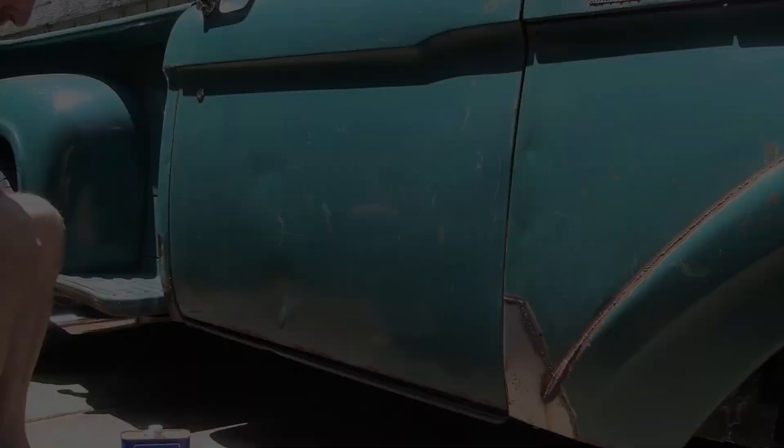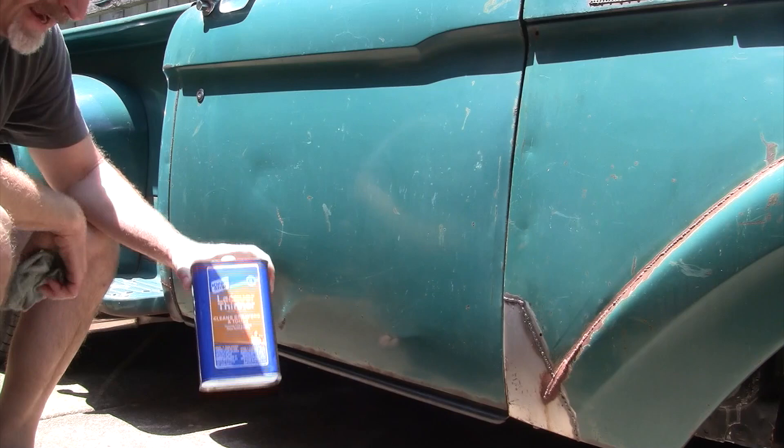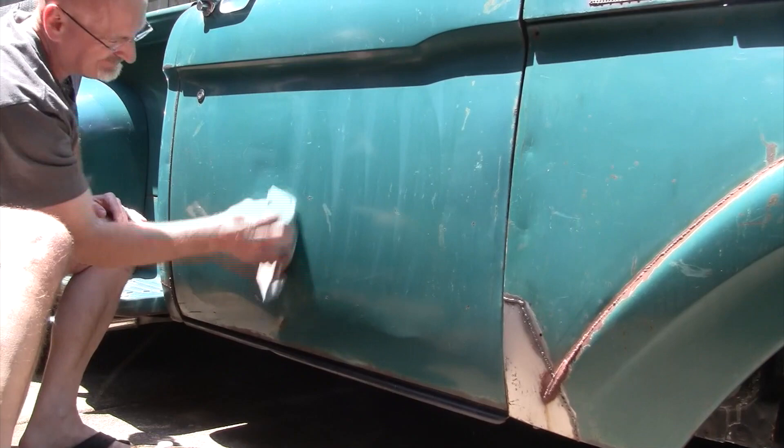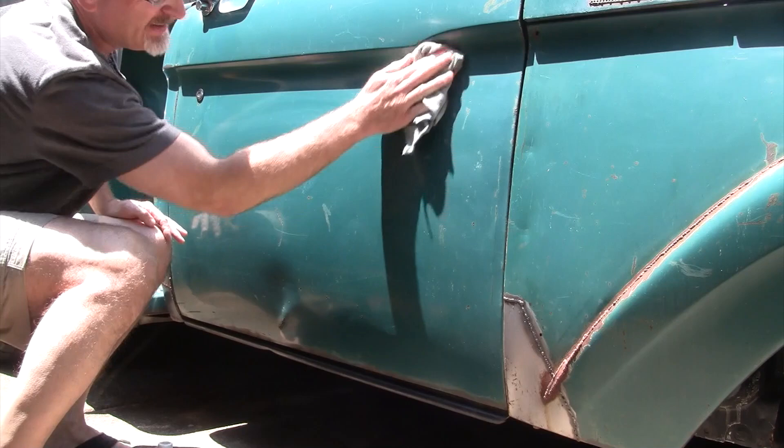So this video is going to be basically focused on how I'm going to complete the door logo. Hope you enjoy — welcome back, I know it's been a while, and I'm going to follow up with a later video on some other little updates on the truck. So let's jump in and get going. To get the doors prepped we're just going to take a little lacquer thinner and give it a good wipe down to get any old wax or rubbing compound off the area so the enamel will have good adhesion.